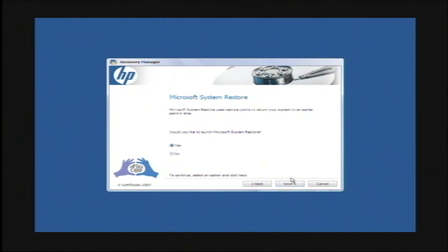And if I click next here, with this particular software, it's going to launch the HP software that will restore my computer back to its factory settings. And basically the next time I boot, it will be as if I had just gotten the computer. All my files and programs will have been erased. And if you're using a laptop, it's a good idea to plug that laptop in because this might take an hour or an hour and a half to complete.